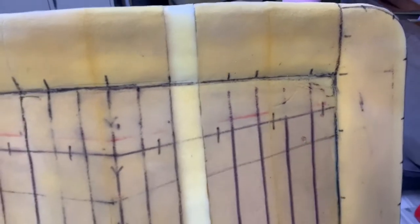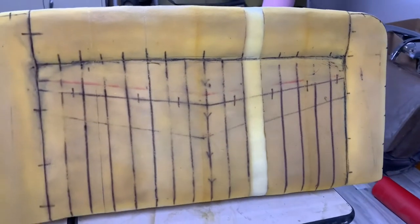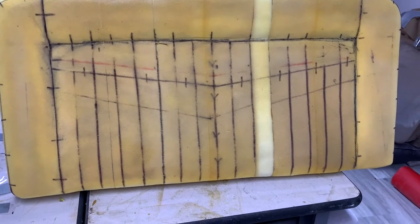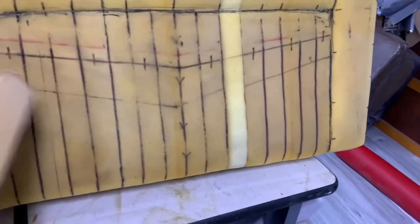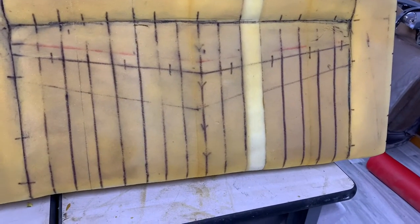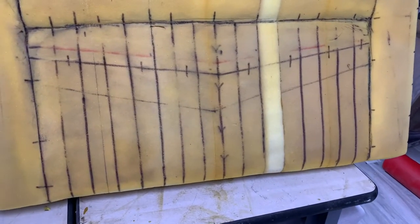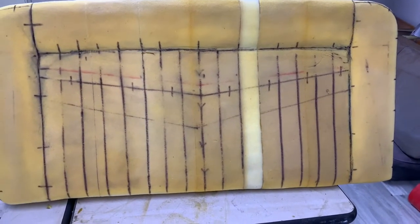They'll be laminated together just like this right here, all the way across. You can see how I ended up cutting one down and putting it in there as I designed the seat. I used a black marker to do my design on it. The V on the bottom was a little too much, the red line on the top was just not enough, so I compromised. At one point I had the corners rounded, but now I went back with a squared look.